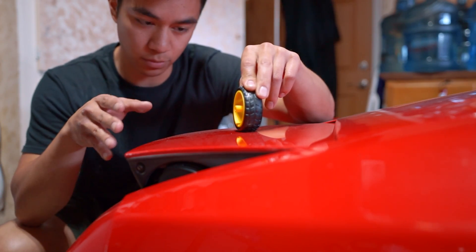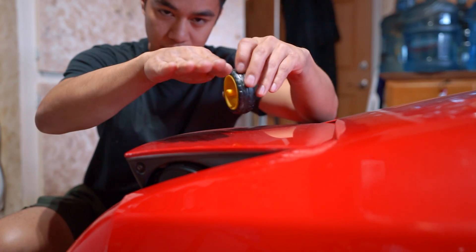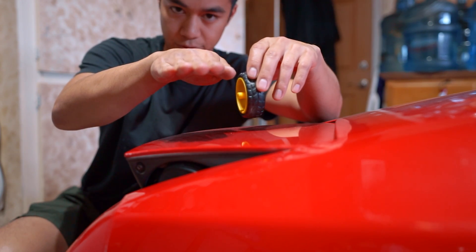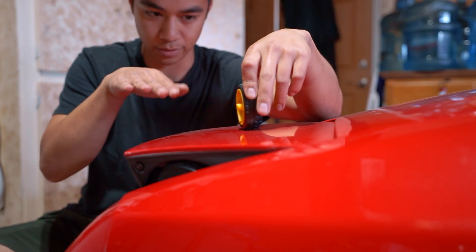For an ideal amount of grip, you want the tire flat with the road. This means you have the most contact patch available for cornering. A well-designed suspension is meant to camber out as it compresses, which means as the car corners, the wheel gains camber at the same rate it rolls, keeping the tire flat. And this all applies during peak cornering.